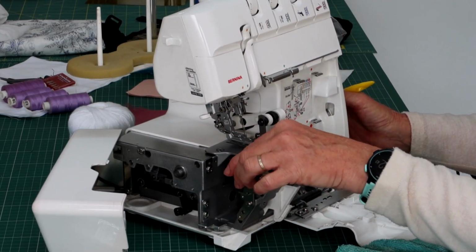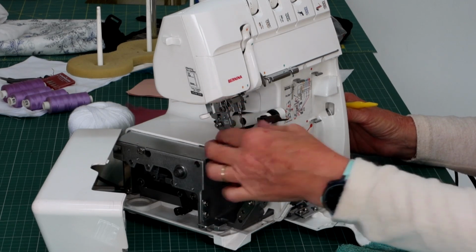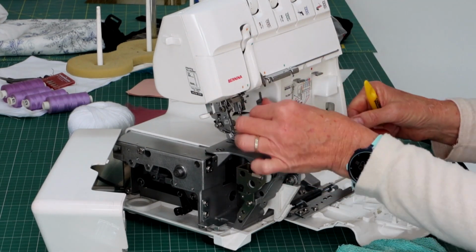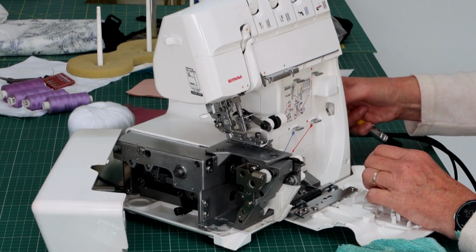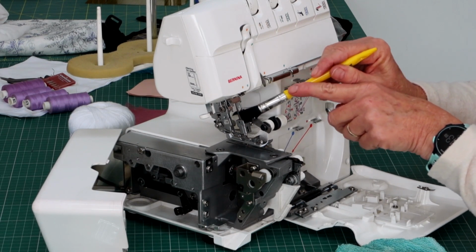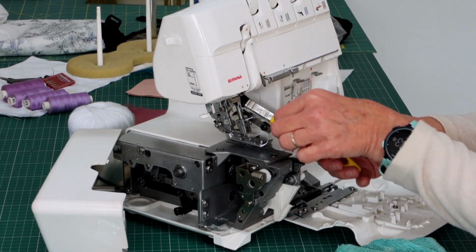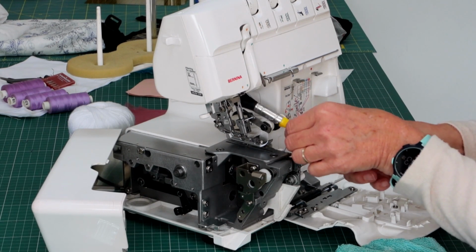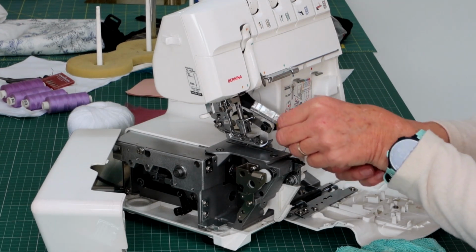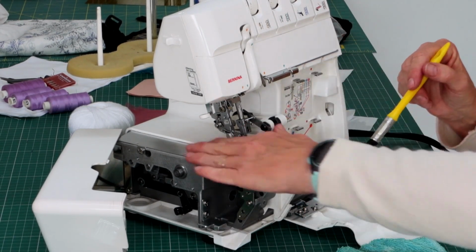Anyway, this is a lovely machine as well because the pressure foot does swing out, so that is for ease of threading, but we're not really going to concentrate on that. It does get fluffy and dirty in that section, so you can keep that nice and clean. I'm just going to turn the blade back so we don't hurt ourselves. You can once again lower down your shaft so that your needle bar is completely at the bottom. Keep that area clean. Once again, with the oiled brush tip, push it up here. Just dab it like that, and you can grab, still no fluff, Elsabe. You can grab your fluff up here, and then you wipe it off. Not everybody's machine is going to look so beautiful at home, so you just keep it clean, wipe it off. You can take your paper towel and clean it as well.